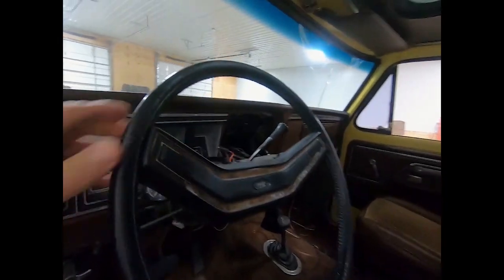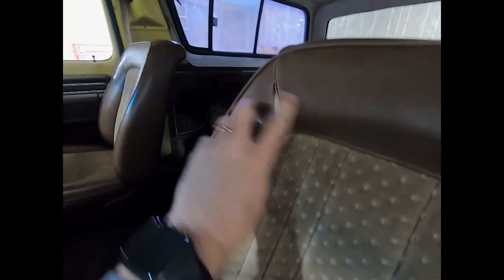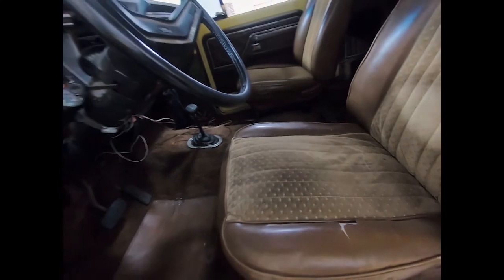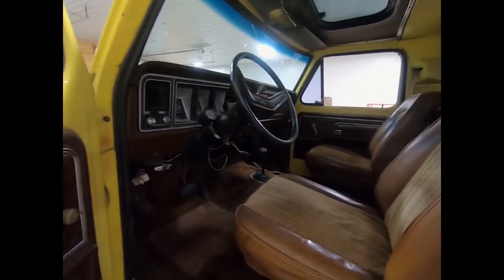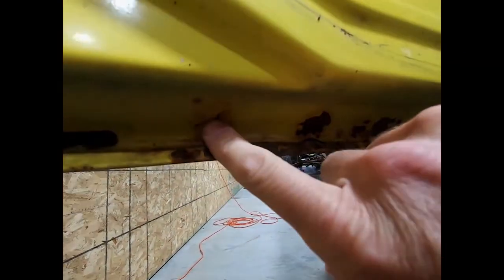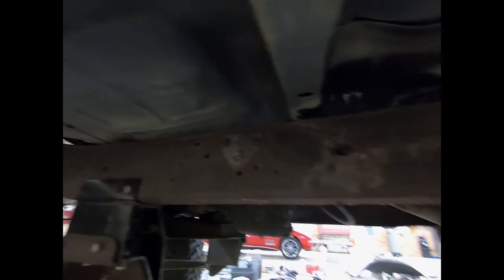Here on the driver's side, the steering wheel is in really good shape. The seat has some cracking and a little bit of separation, which I'd expect just from age, but the velour is not worn that bad. Looking at the carpet and the vinyl heel insert, I just don't see a lot of wear that would tell me it has more than the 70,000 miles. The rockers all look so dry. The bottom of the doors has some rust, but it's not through — it's easily treatable. Underneath it's all very, very good and dry.